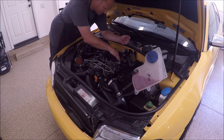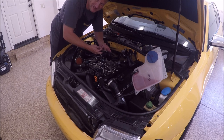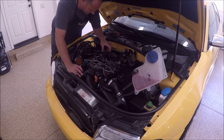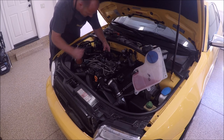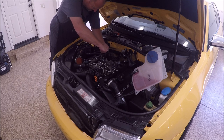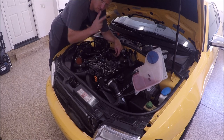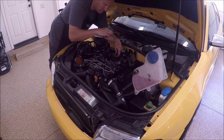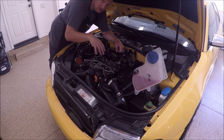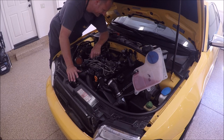That's all I'm going to do - just push it out of the way. On the older S4s it's just one piece that goes to the intake manifold - a check valve from here down. This is a little more involved and quite often these things come apart and break. The way I got this off: if you put a little screwdriver right here and kind of wiggle it around, it'll pry these things out enough that you could just pull this out. It takes a little practice, but trying to squeeze these in such a tight area - good luck.